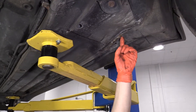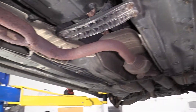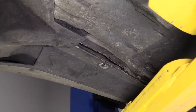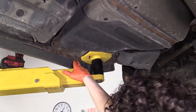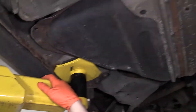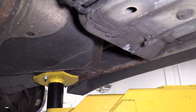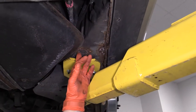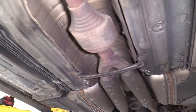You can see someone has done all four lift points on the pinch rail — as they call it — and they have pushed the car up. Even in the back here, you can just barely see it pinched up a little bit. Definitely more on that side. So I set my lift up on the actual body rails, which is a thick steel rolled section, and it's more secure and a better place.